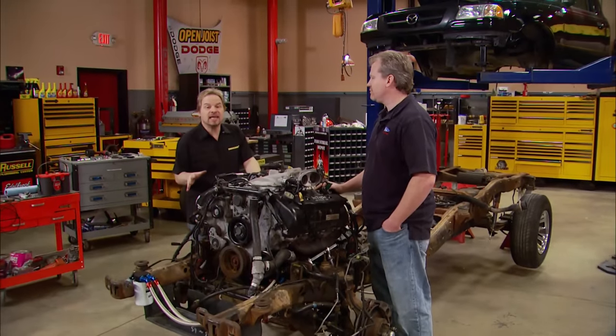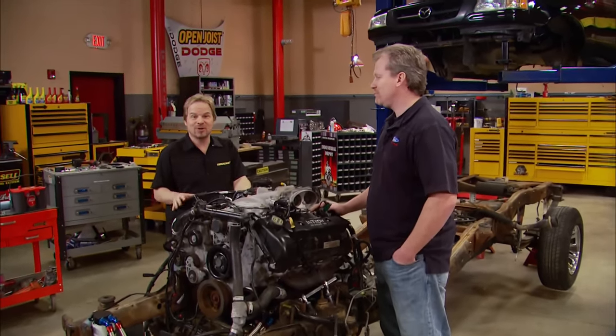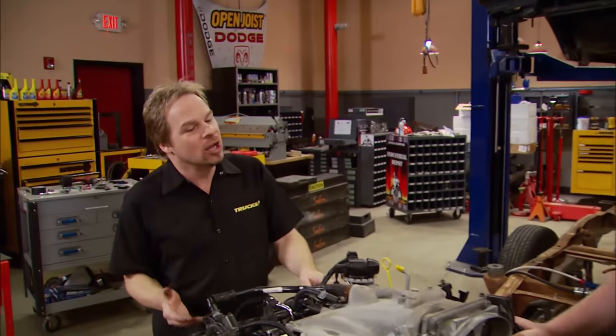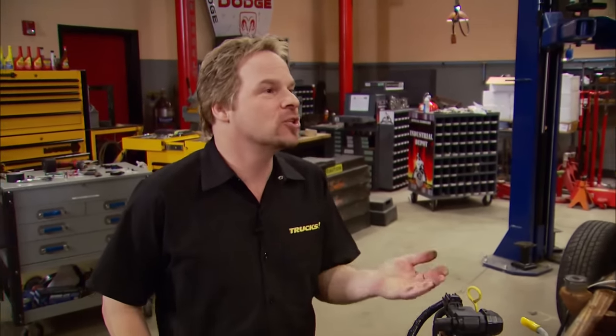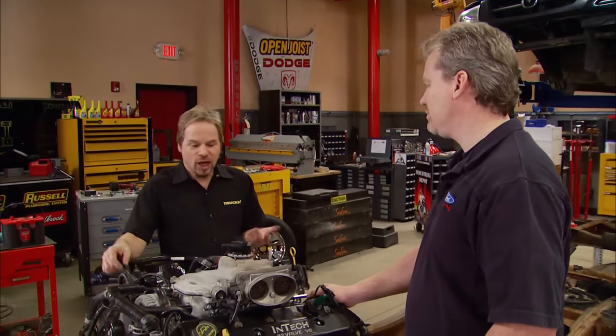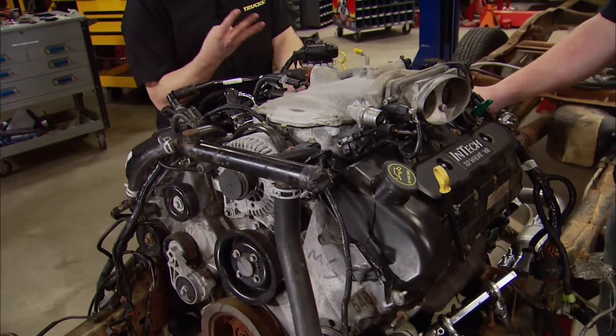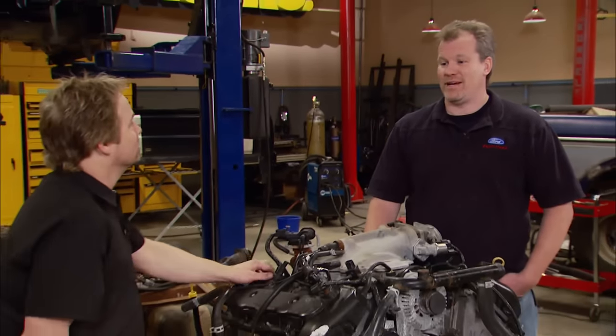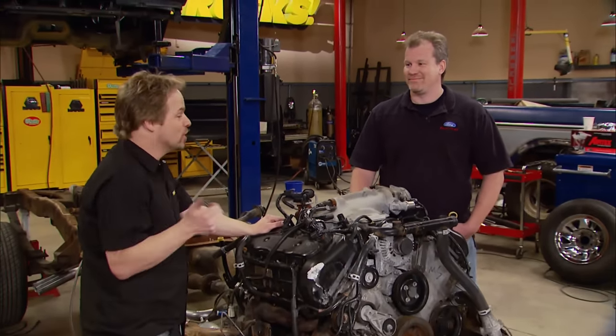In case some of you Chevy guys have forgotten, it was the Ford that won the muscle truck series. Even though EFI is nothing new, there's still a lot of guys, including myself, that get a little intimidated by the voodoo involved in wiring an EFI engine swap. A lot of people see wiring one of these engines as sort of a black magic — while we may not eliminate the mystery, we've done a pretty good job to eliminate the complexity. And you're telling me there are only four wires I need to connect to make this thing run? Just four: battery positive, battery negative, a fuel pump, and a 12-volt key-on. That's no more complicated than a carbureted engine — not with our kit.